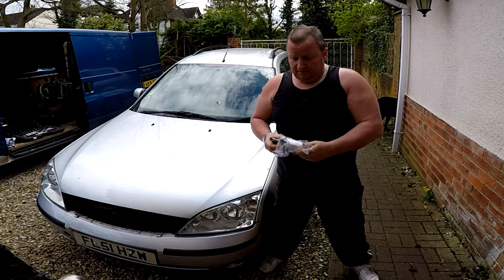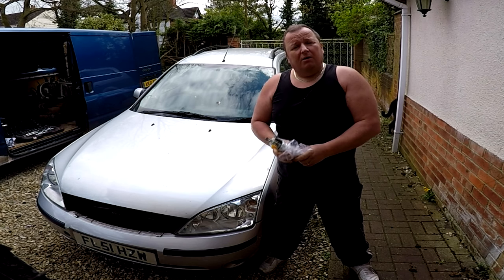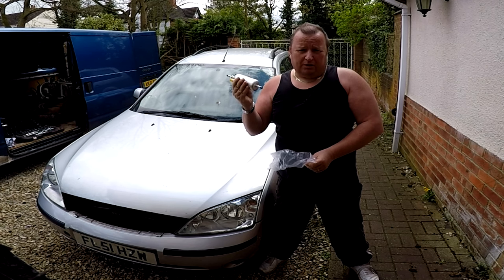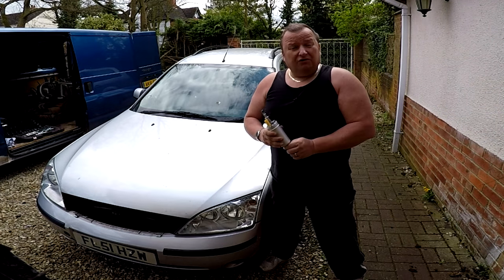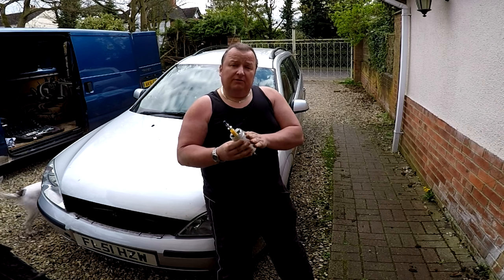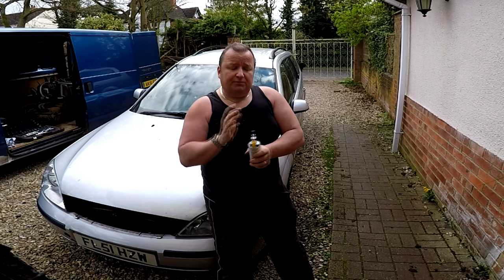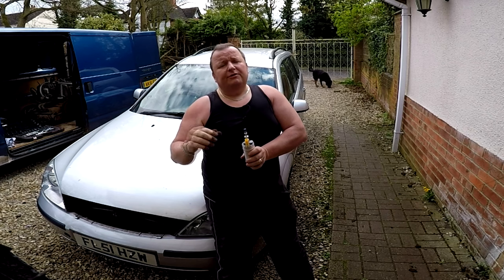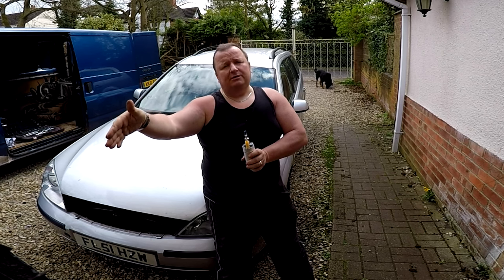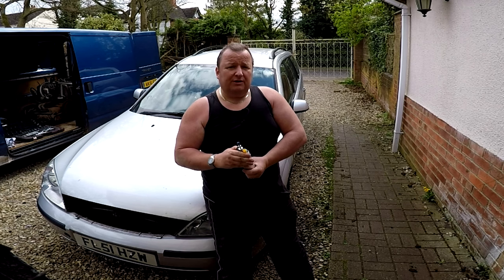I've had a little look around the forums again, and if this was my only resource then I might have gone down the pathway of spending on any one of those things I've mentioned. But now, because the lift pump is an unknown quantity, I've actually had to go out and buy a new one. This cost me 98 pounds, and I've gone down this road because there's a number of people who have had exactly the same problem. Bearing in mind that the lift pump hasn't got any electrical sensor cables going to it, so there's no record of what it does or how it's performing registered in the fault codes we've been getting. If there is a problem with this supply pump that feeds the fuel from the tank via the lift pump to the high-pressure pump, and we haven't got enough fuel entering the engine, the only codes we're going to get are the codes coming from the actual fuel pump itself. If you remember in the last video, I was looking along the lines of possibly going down the road of an electrical fault.